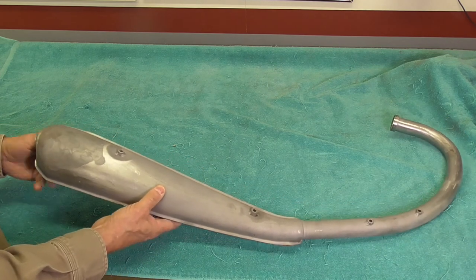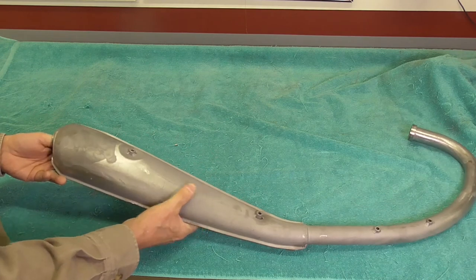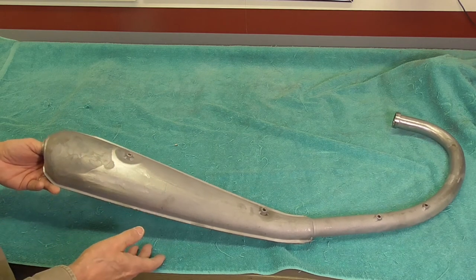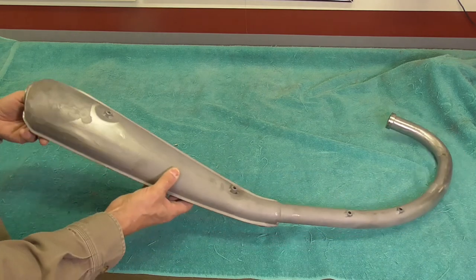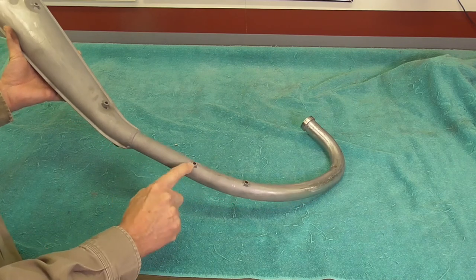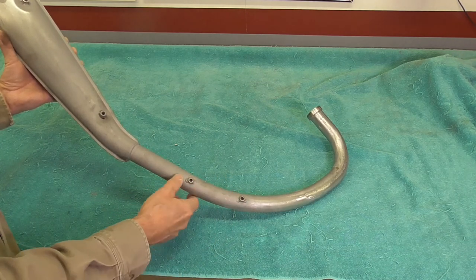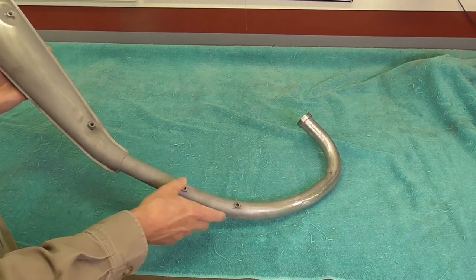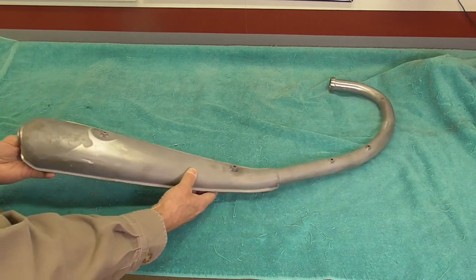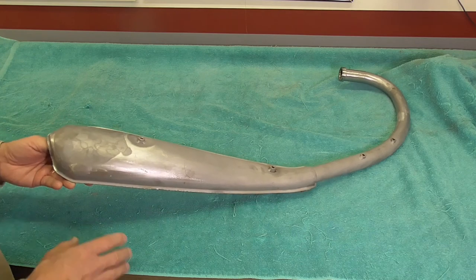The rest of the exhaust is pretty much ready to go outside of just a scuff sanding with probably 400 grit paper, and then I'll clean it really well with acetone and/or brake cleaner before painting. In order to paint it I'm going to have to figure out a way to suspend it — I think I'll use these six millimeter nuts that are welded on here for the boot guard, put two bolts in, use a piece of copper wire, and suspend it so I can get all the way around and paint it effectively. I'll try to get a couple of stills in the process of painting it, but I'm not going to video the entire process — it's pretty academic.